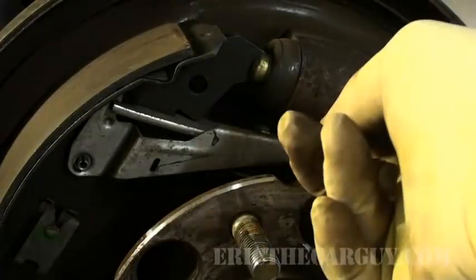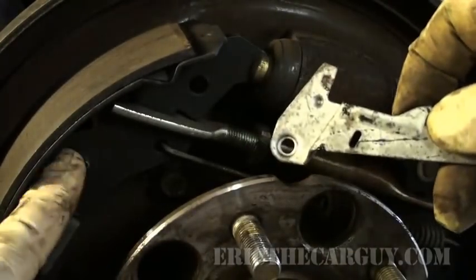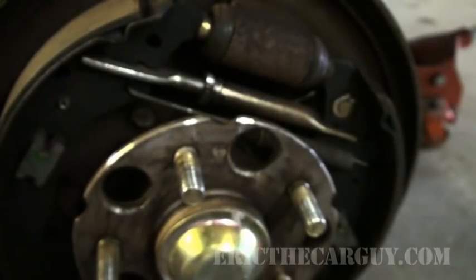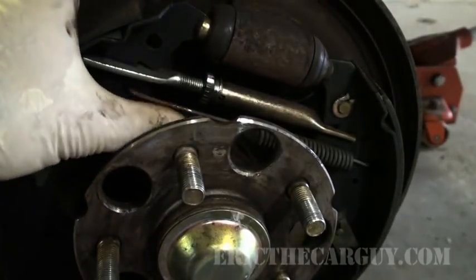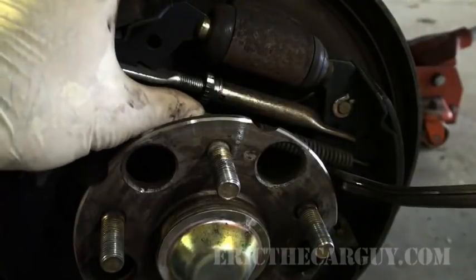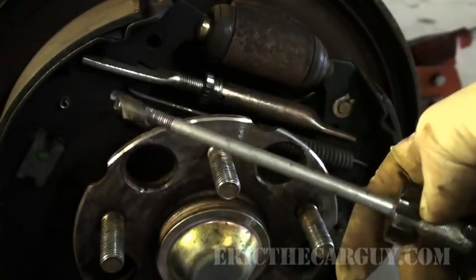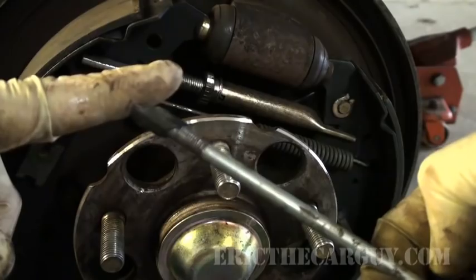I'm putting parts over here — we'll call this dividing line the hub — so I'm putting the parking brake lever right by that spring so I know those two things are connected. Next I'm going to remove the parking brake lever: just lift up — there's a little peg sticking out of the shoe that it's resting on — so all I have to do is take it off. Here's the spring that's going to make you curse. It has more tension than any other spring in this whole job and can be kind of difficult to unhook. They actually make special tools for it.